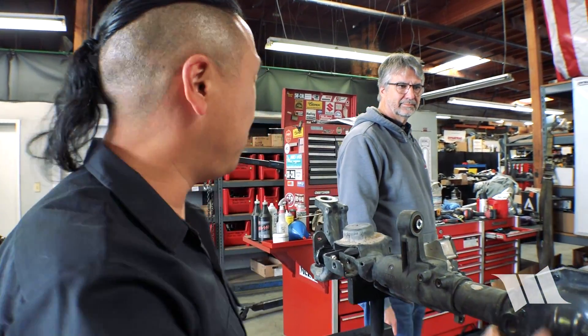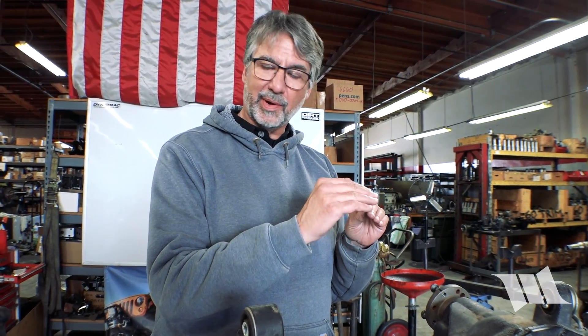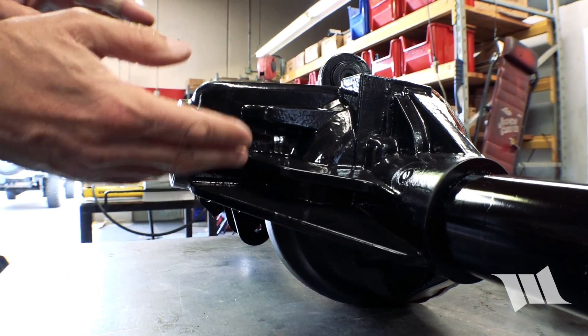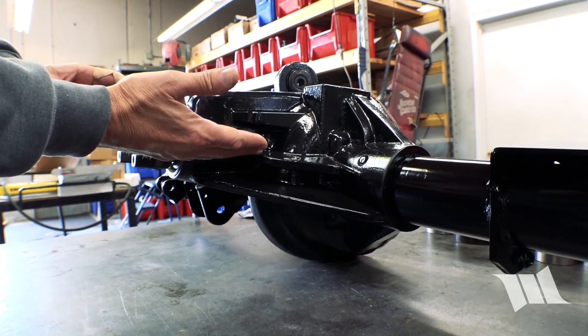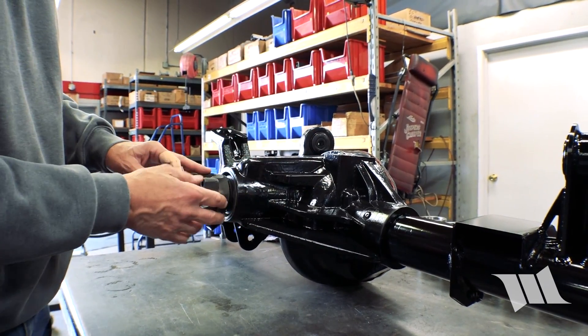A lot of axles on the JK and now the JL have typically been a high-pinion design. What's the difference between the JL and the Pro Rock 44? The pinion on the JL 44 is 3/8 of an inch lower and also longer — it's lower partly for efficiency, as a lower pinion relative to axle centerline creates less friction for a tiny bit better fuel economy. The JK gear set's pinion is 3/8 of an inch higher and about half an inch shorter, allowing a slightly longer driveshaft. The higher pinion also improves driveshaft angularity and gives a little more strength despite slightly more friction, so the JK ring and pinion setup was better to go with.